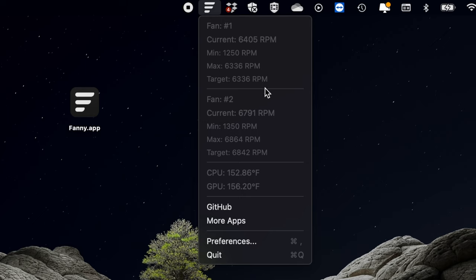You'll straight away see the maximum and minimum speeds of your fans listed. My two fans are actually running quite fast right now because my Mac is quite busy. But if your fans are always running at high speed, it means your Mac is really hot and it's trying to cool down. If they're still running really fast and you're still seeing very hot CPU and GPU temperatures, there could be some other underlying problems. It's not uncommon for a CPU or GPU to run at around 200°F, but I wouldn't recommend it for long periods of time. Try to generally keep it under that, and if it's always running at that temperature or hotter, be concerned and look into why that is happening.